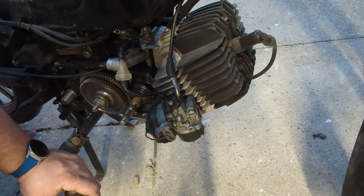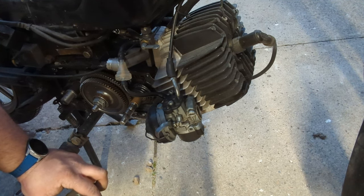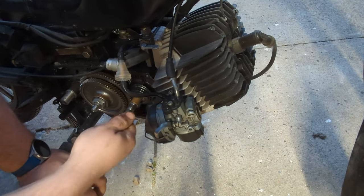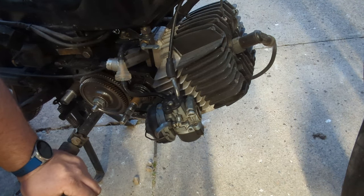The same thing happens with flywheel locating pins, but in this particular case I could have just gone and got a three-jawed puller, but that would have pulled half the threads off this spindle, which is the crankshaft, and didn't want to do that. So it's off now, time to clean up the other one and put it on.